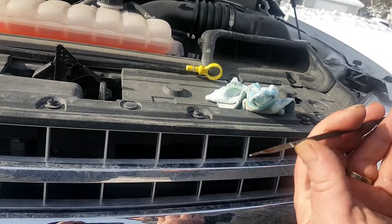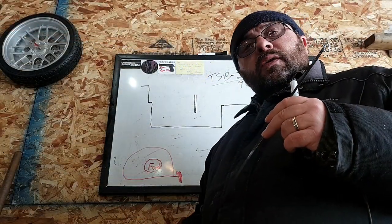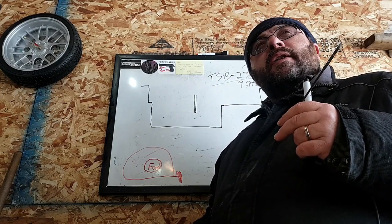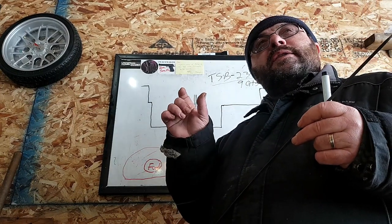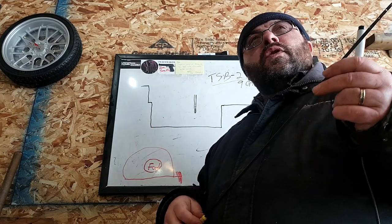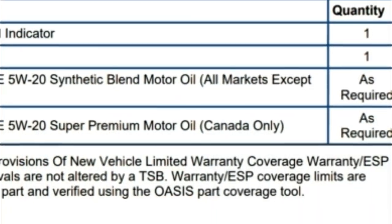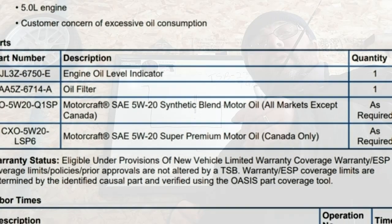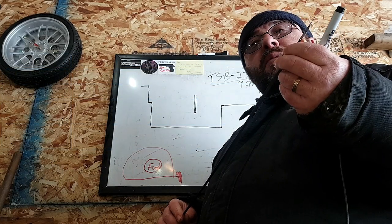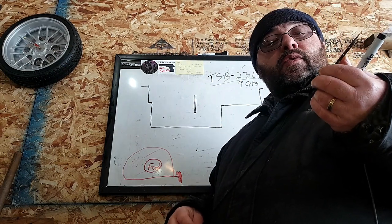So it's down on your dipstick, but the difference between the dipsticks — what this is showing right now is she's right at the top add line. That had me thinking: what's Ford really trying to hide? I went back and looked at Technical Service Bulletin 2365, and it said change the dipstick, go through all the other procedures in the other bulletins, and add oil as necessary. That 'add oil as necessary' got me thinking — if his dipstick is down a quarter of an inch and I put mine in and it's right on the money, that's nine quarts, which is what every Ford F-150 left the factory with.